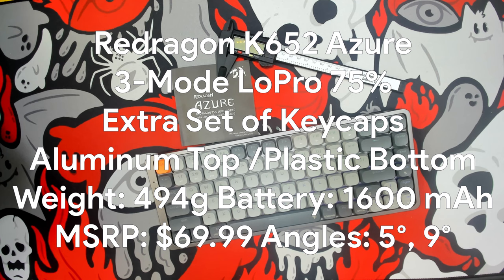It comes in weighing at 494 grams and has a battery of 1600 milliamp hours. The chin of this keyboard sits at 13.5 millimeters from the surface, while the back sits at 20.5 millimeters, providing for a default typing angle of 5 degrees. Raising the included pair of feet, you will raise the back to 28.5 millimeters off the typing surface, changing the default typing angle to 9 degrees. This keyboard's MSRP is $69.99, though it is currently on sale for $59.99.